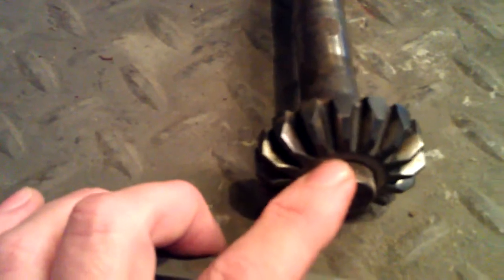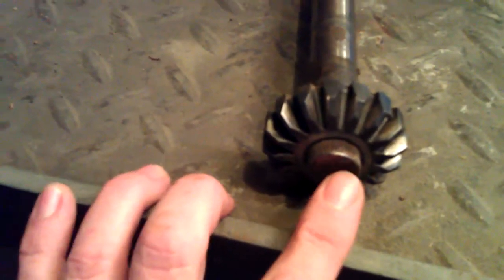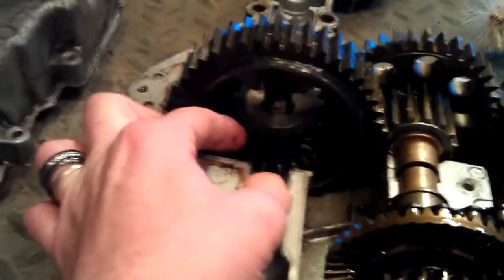I think I got it set on macro. There's a little bit of grit in that one tooth - I hope this is clear. So that one's all prepped and ready to go, and that one's all prepped and ready to go. I'm going to run a bead all the way around here, then I'm going to grind the tip of this off so it'll fit inside the bull gear - that's the bull gear - and then put everything back in.